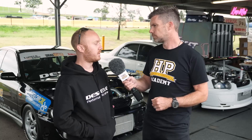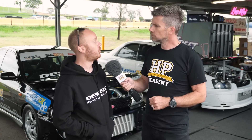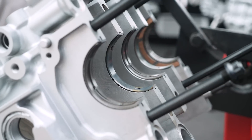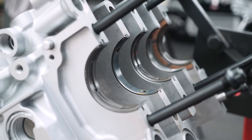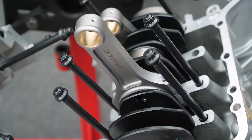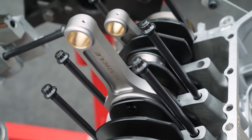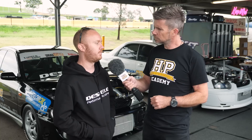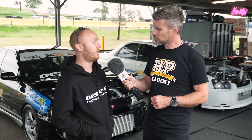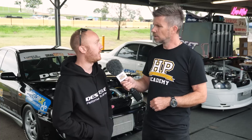Mainly supplying enough oil because the block does grow a lot. A lot of people building the motor tend to set the clearances too loose on the mains — that's one of the main critical points where people go wrong. We actually tighten them up because when they get hot they expand. We go to a bigger oil pump for more flow, run a good viscosity oil, and if you have pressure and no pickup problems, you will eliminate the issue by tightening those things.